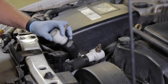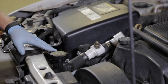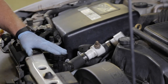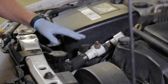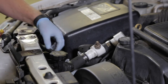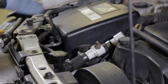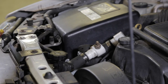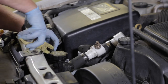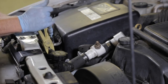In preparation for the flush machine, where we're going to pressurize this cooling system, you have to recognize that the flush machine is pushing coolant around the system with pretty good pressure — basically whatever pressure the cap is rated at. This one's rated at 15 pounds. So if we apply that pressure to the cooling system and our overflow recovery hose is connected and open, then that coolant can push right out and overflow into the recovery tank, pouring coolant all over the ground. So what we do is use a smaller set of clamps, clamp this hose off, and leave this on during the flush process.